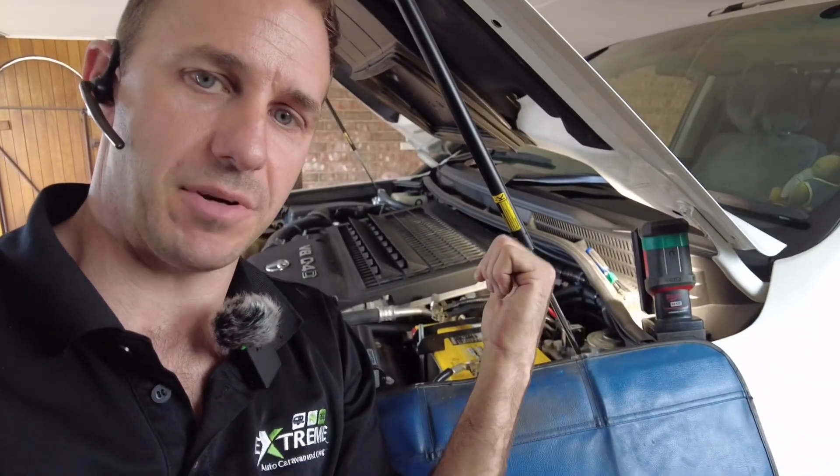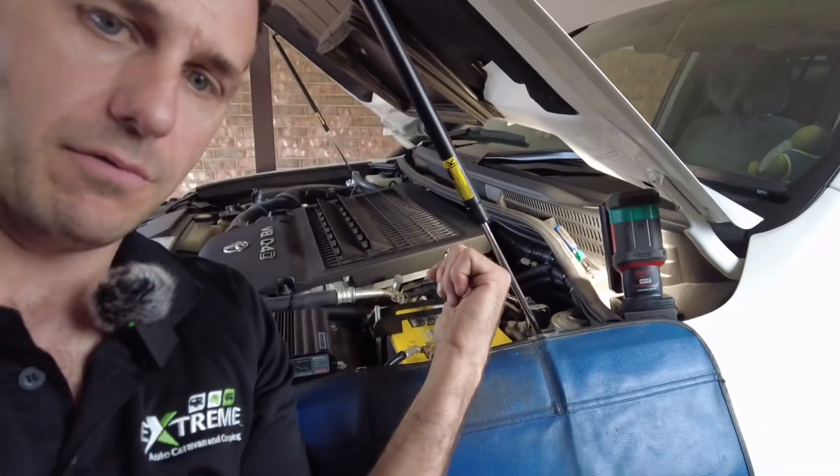So what's the problem? You can't have a DC charger charging a battery that's running an Anderson plug that's charging another DC charger that's charging a battery. What will happen — and what has happened — is this battery is going to go flat. And it does, and it's happening. What's even worse is the voltage on this flies down so fast because it can't keep up with the new lithium battery DC charger that it just shuts off. So that DC charger some eight metres away is shutting down as well. You can't do it — that's why we're having problems.